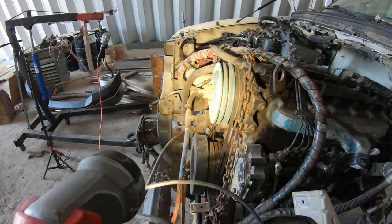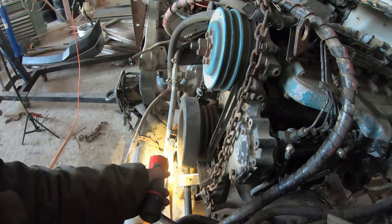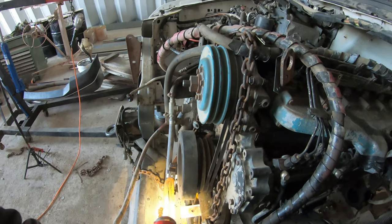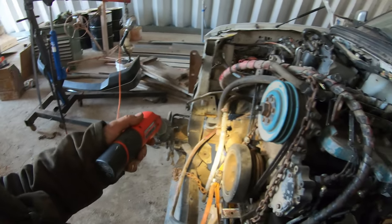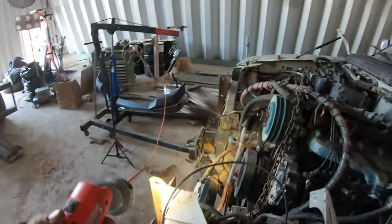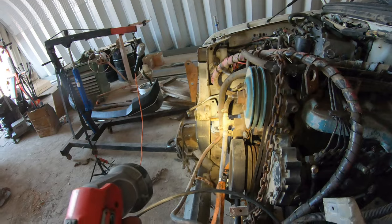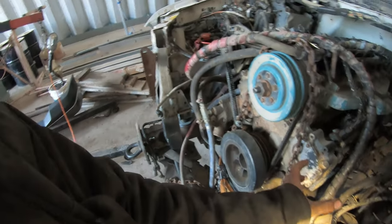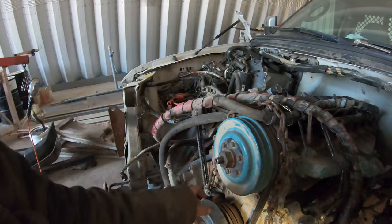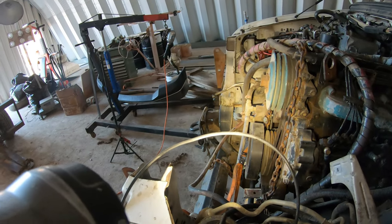I don't think I'm going to be able to get the fan from the truck in there. You can see there's the rubbers for the radiator — I should be able to fit the radiator in there; it's going to be really close to the flywheel but it'll fit. I got an intercooler from a six-liter, same year — I went and got a good radiator and a good intercooler, so I'll be using a six-liter intercooler which is bigger than the International one and pretty close to the same size tubes. I'll have to put electric fans in it — probably won't be able to put an electric fan between the radiator and the harmonic balancer, so I'll probably just have two smaller fans on the side. So it'll be radiator, intercooler, electric fans.